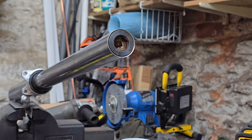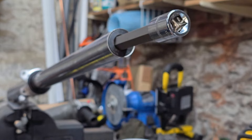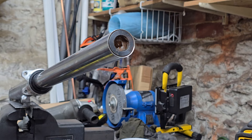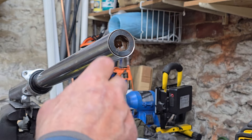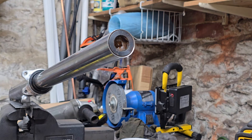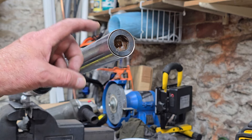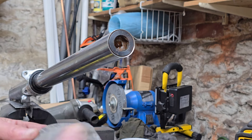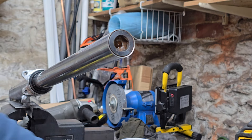These happen to be 17mm. What we're going to do is take this cap off - one of two things could happen, it might go shooting over that way. Sometimes they do, sometimes they don't, depending on how much pressure they're under. These forks are really quite soft so I can't imagine there's a lot of pressure, maybe none. The reason I've got it at an angle is because this should be full of oil.